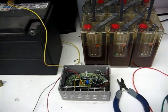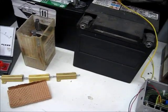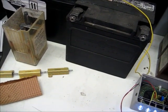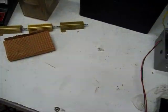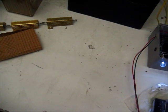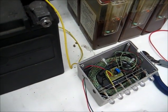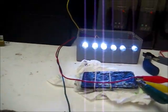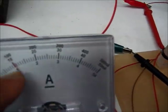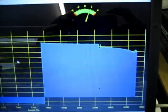Now if we just hook up the oscillator to it — you can see, there it is. So let's just hook it up. I've got my oscillator running with plenty of light. I'm drawing 110 milliamps with this oscillator. And you can see I've recovered. I'll come back and show you where this is going to go down at. Anyway, I've left this on here and it's drying out pretty good. There's no — the crystal is forming, it's getting dry inside. It's at about 50 milliamps now, and you can see what the curve is. And that's a lot of power for a 10-minute charge — just forming it, not even really formed yet. But it's typical of a crystal battery to do exactly that.